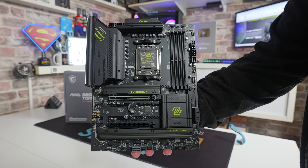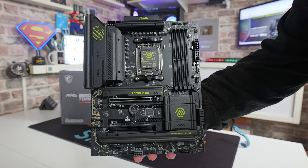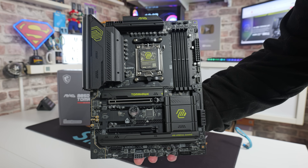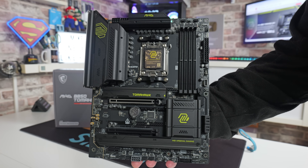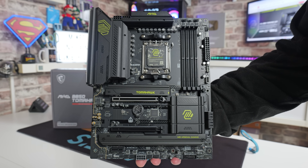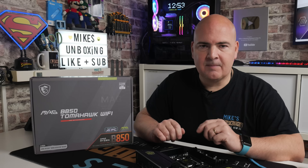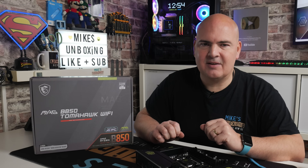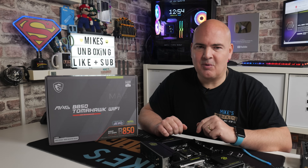Which is why we make these videos — because manufacturers tend to have very subtle differences between model numbers, names, etc. So getting the right BIOS for your motherboard is paramount. For that reason there will be links in the video description directly to the MSI website so you can pick up the correct BIOS for this board. If you have the Max version of this board, this video is not for you. This is purely for the B850 Tomahawk Wi-Fi, which is a new revision of that particular board.